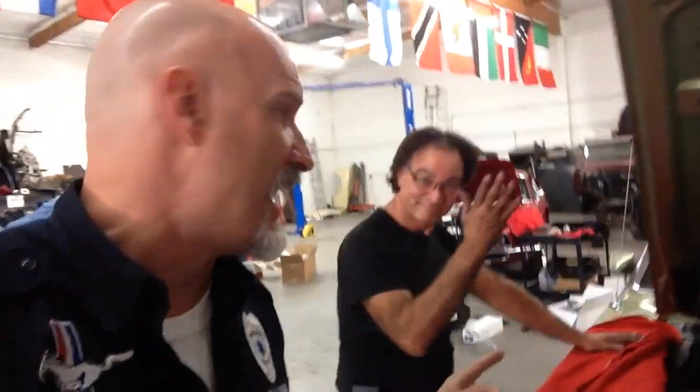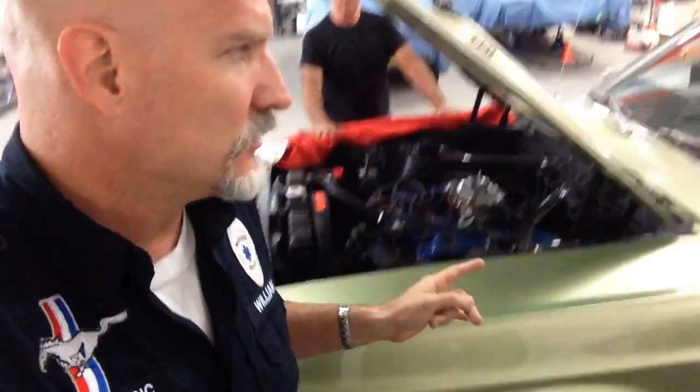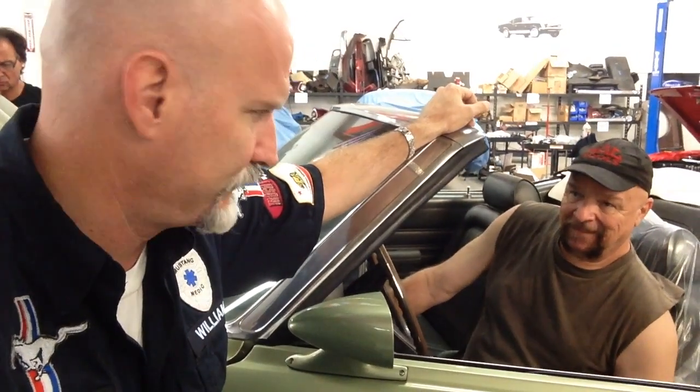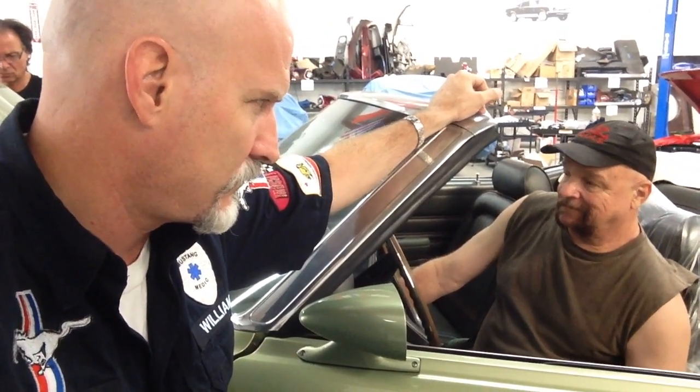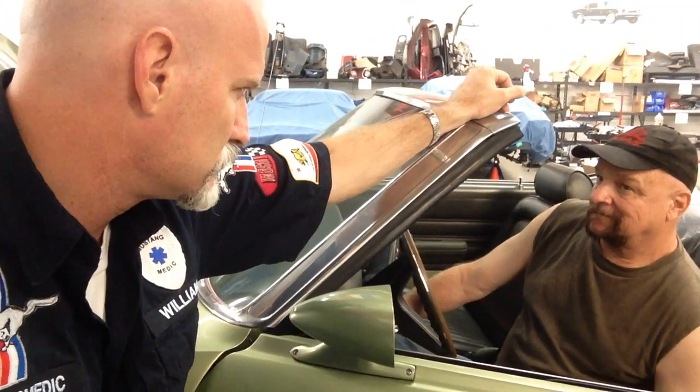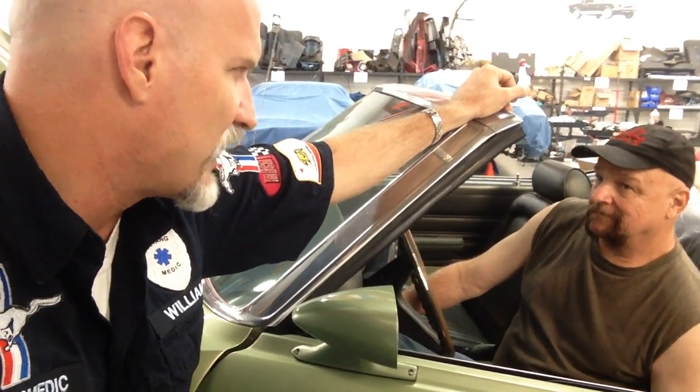Andrew has put back on the bell housing, and we've got her running without the torque converter or the transmission, with a rebuilt motor. Joe is warming her up, and we're waiting for a report. Does she have vibration at 3,000 RPM? Approximately. No, she doesn't have vibration. Okay, you got a little bit.